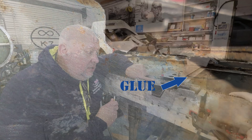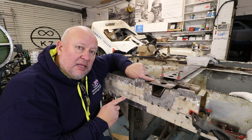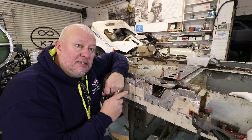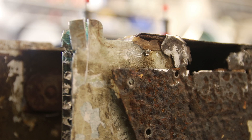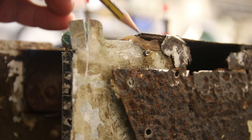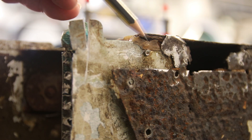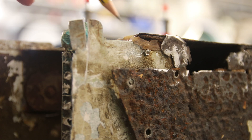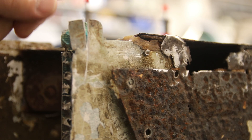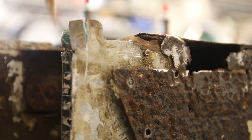So I had a look on the inside — it's a bit difficult to photograph but you can see there's the same gap with a quarter of an inch of glue, and I thought that's not right. It's not crash damage, it's always been like that. So I went around to the other side. The end cap's been taken off the cross member on this side — the other side hasn't been touched — and you can see quite clearly that that edge is well below that height. There's a quarter inch of glue in there, and it's obviously always been that way: a quarter of an inch below. It's been like that from birth, hanging on these lumps of glue, which of course have failed.